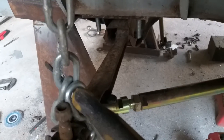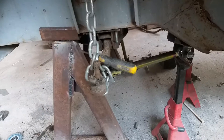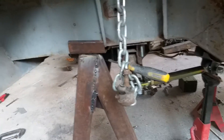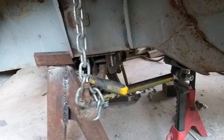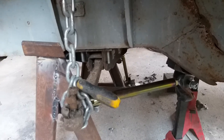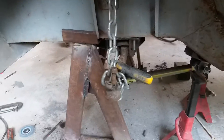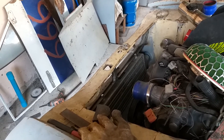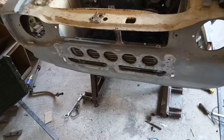I've also started having a look down here. We're gonna get on mounting some compression struts, and the way that is supposed to go is angled up and back to give you your anti-dive when you're braking. The only way I'm gonna be able to do that is to put all the suspension in and see what sort of ride height I can mock up, because I'm putting the steering rack on the back here so the steering arms have got to come through there. That's another little thing to put on the list, and that's about all I can report on today — just quite a lot of faffing about trying to position things, so I'll catch up with you all later on.